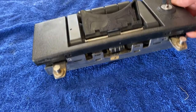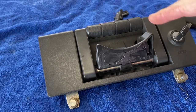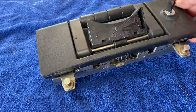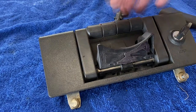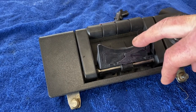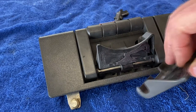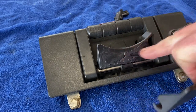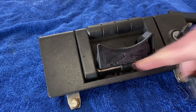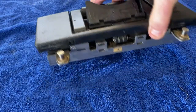What's broken on it is this top piece, which opens the bag itself — not the latch that holds the bag to the bike, thank God. What happened was I was using the bike yesterday, went to a destination, needed to open the bag and put some stuff in it. When I did that, this cover came off, which is apparently glued or bonded there, which holds these guys in, which holds that against this pivot shaft here, which activates the latch.